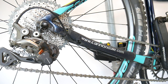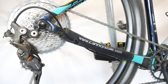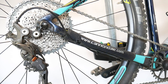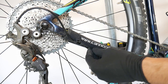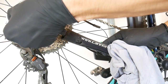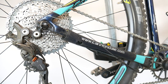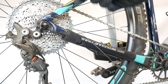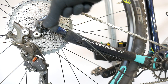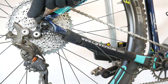Here's the second thing we can do right or wrong. I'm now changing the gear into the lowest one. I always clean my cable before opening the housing and looking at what's inside — there is nothing inside, and that's right. But when we leave water or some dirt in there, there will be more friction. The water is the worst because the cable, when it doesn't have a high quality coating, will get rusty and it will snap.